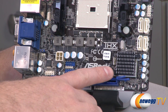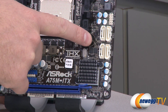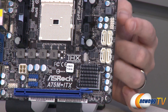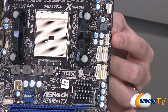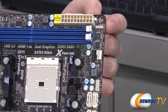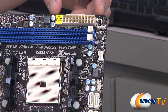Moving to the right side of the board, there's a passive heatsink on top of the A75 chipset, which controls the four Serial ATA ports — all SATA Revision 3, six gigabit per second, compatible with high-end SSDs and mechanical hard drives. Above them are the white front panel connectors for your hard drive LEDs and power and reset buttons. Moving up the side, you have the four-pin chassis fan connector, a COM header, and a speaker connector — helpful for POST beeps when debugging your system.